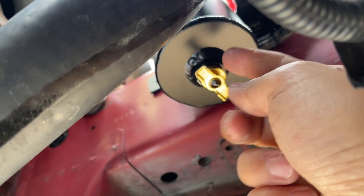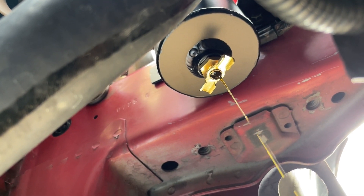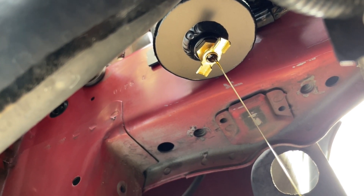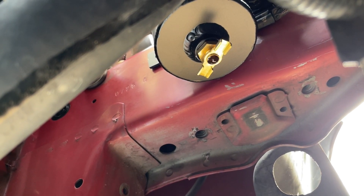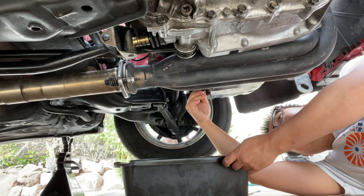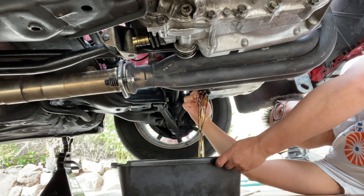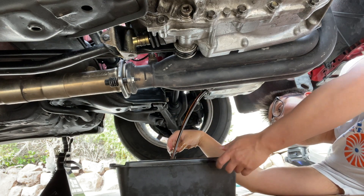I'm doing a quick oil change. I wanted to see how much oil is collecting in the catch can after about 150 miles of break-in driving and if there's any flakes in the oil. Not much oil accumulated in the catch can, and only a small amount of flakes were caught on the magnetic drain plug, which looks perfectly normal to me.